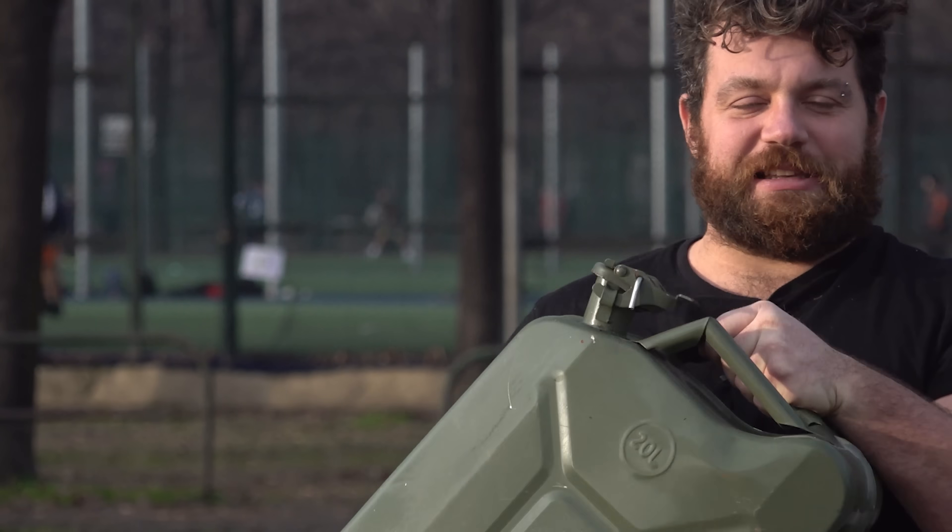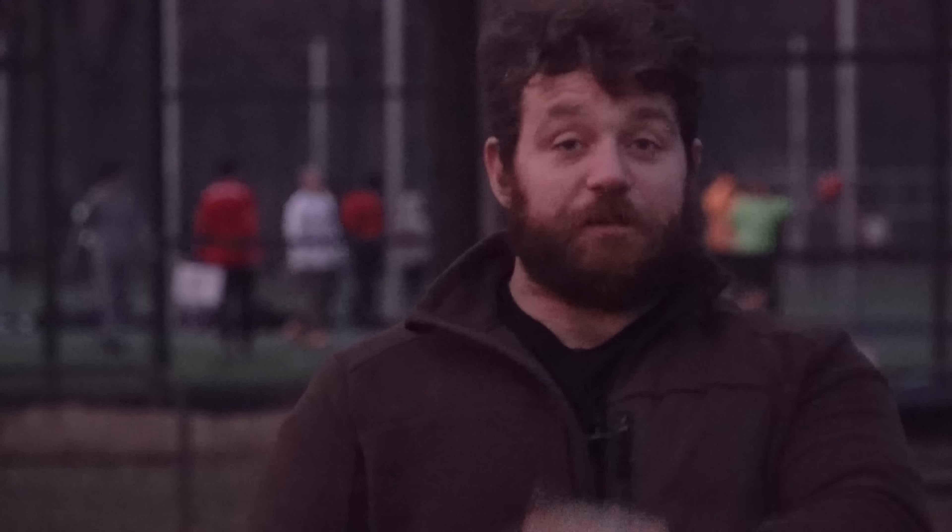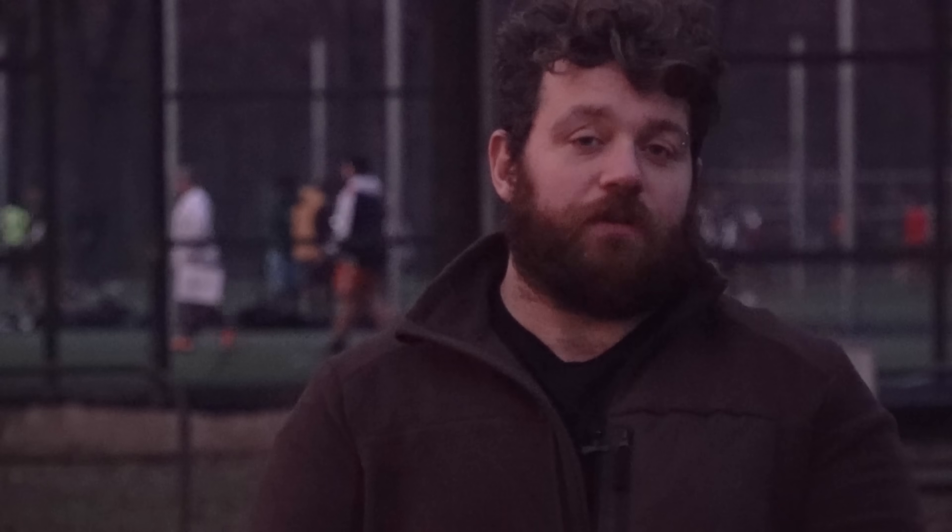I really suggest that once you put biodiesel in your car, you mix 50% of this homemade biodiesel with 50% of regular diesel from the gas station. Since this is self-made biodiesel we don't have laboratory instruments to test its quality, and mixing the two together gives a much more fluid result — cold weather increases the viscosity of biodiesel, so blending them is ideal. I'm going to add 15 liters of our biodiesel and 15 liters of regular diesel. Please take this video as an experiment to learn something new, but don't replicate it without caution — I've used very dangerous chemical reactions and you could also risk ruining your car engine. Check out my two previous related projects, and see you next week in a DIY tutorial!